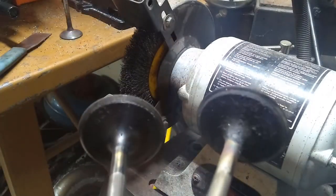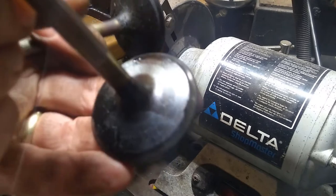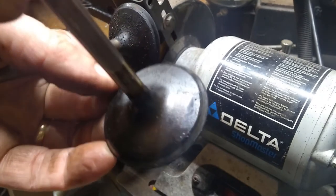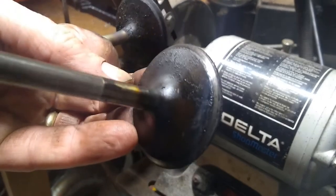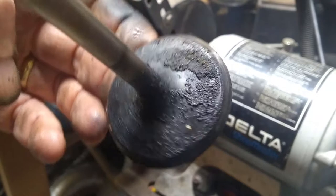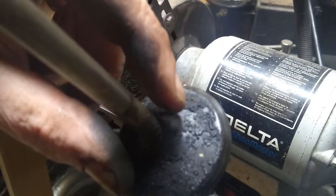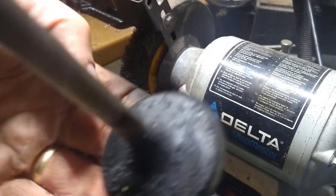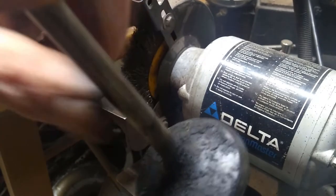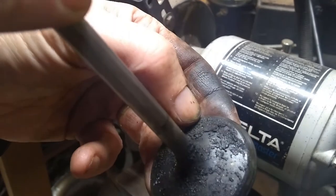Here's a quick look at valves from two different motors. You can see this one — that face is pretty clean; it's a little slick with oil, but that's just from when I disassembled it. Not too bad. If you look at this one, this one's got a lot of carbon deposits on it. That's not a lot — I've seen much, much worse; I've seen where they literally had like half an inch of carbon sticking out. This indicates higher miles, so we were getting a little bit of oil weeping down the valve guide and baking on.